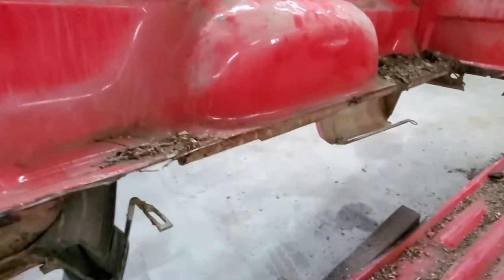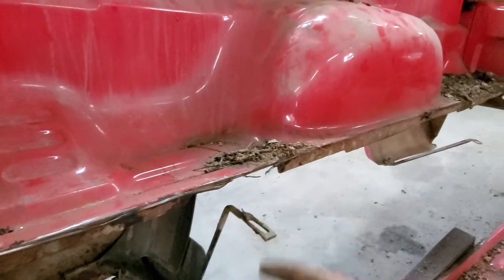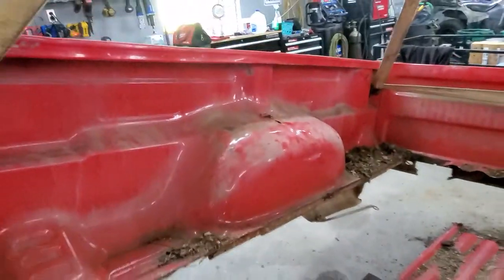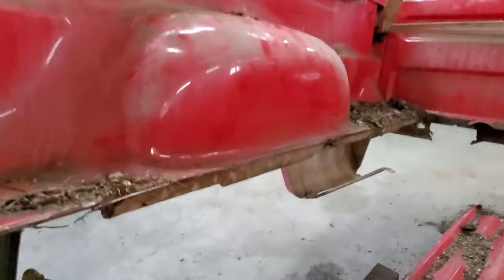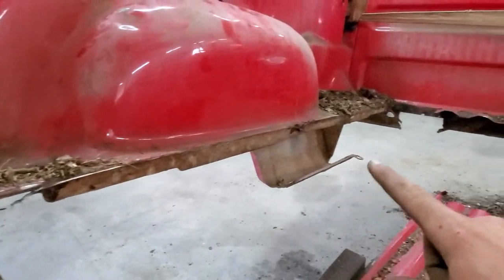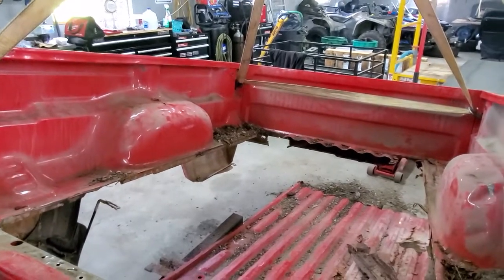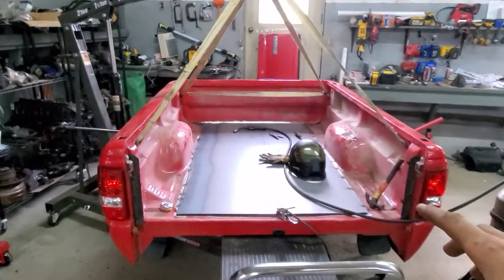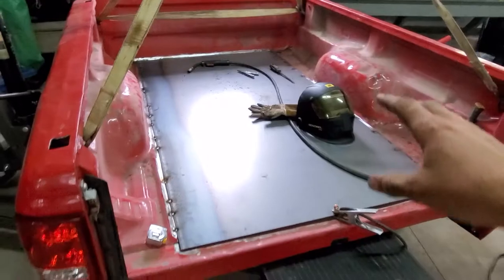On this side you can really see what I'm talking about with the flange. There were spots basically where the crossmember is where they kind of disappear, but for the most part the flange is there — that's where you'll find all the spot welds. You can kind of see the lighter circles all the way through; you have to drill those out and then that middle piece should pop right out of there.